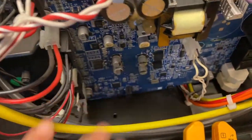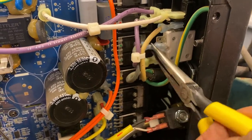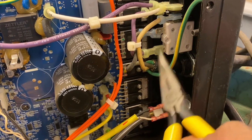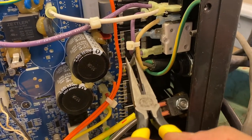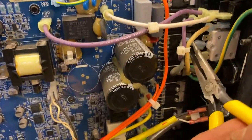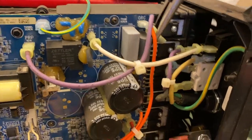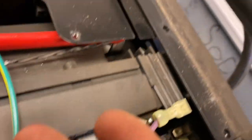If your circuit breaker is bad, you can bypass it for a quick test by taking the lower portion of the switch and connecting the main power from the cord directly to the switch. If the switch itself is bad, take the gray wire and connect it directly to the board — that's the end line of the gray wire. To test the switch, take the top piece and do the continuity test.